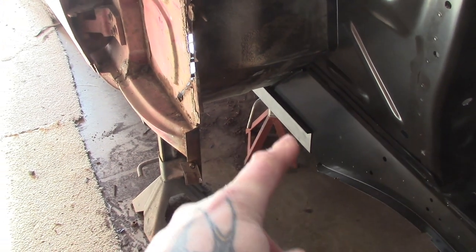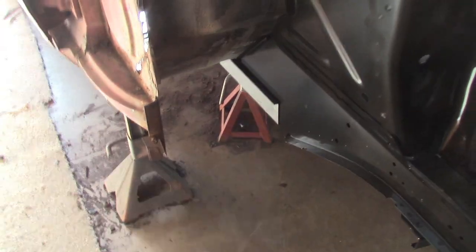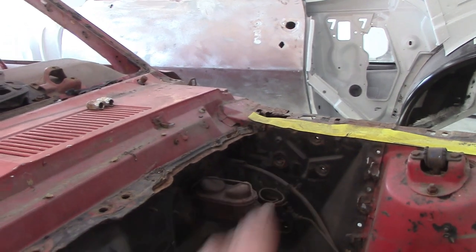I'm back here with you on the Mustang. I'm going to show you what's going on here. We're going to fit this piece in next. You remember in my last video when we were talking about the Mustang, I showed you how this piece tacked in down below your frame rail — your subframe rail. So this piece slides into that, and then there is this top piece that comes with it. It slides up underneath that, just like that one does over there factory.